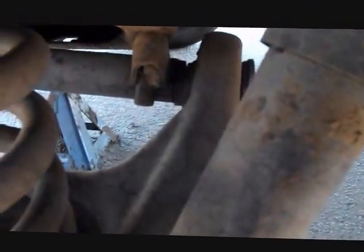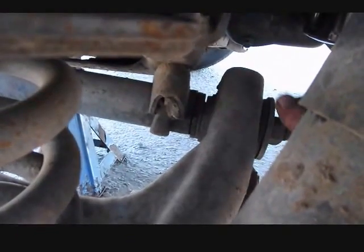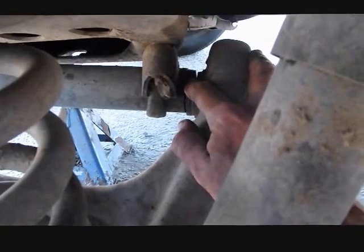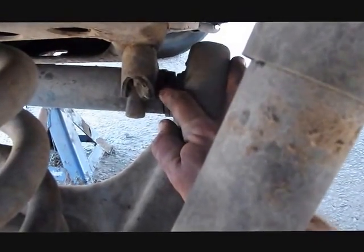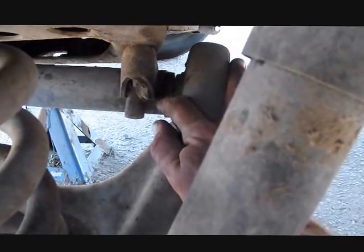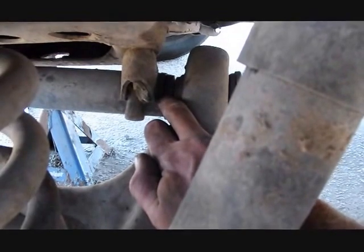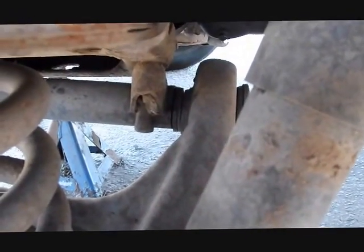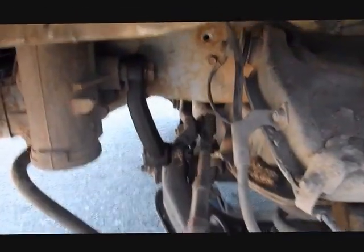I am noticing though, if you look right through here, you see how this lower control arm is sitting cockeyed and lower in here than usual, which is telling me this is where my weird tire wear is coming from. Even when my tires are perfectly aligned, they still wear out to a slant, and I really believe now that's going to be because of these control arm bushings. So maybe my next step in the next video, I might be doing control arm bushings. You never know. Let me keep it short because I ran out of memory.